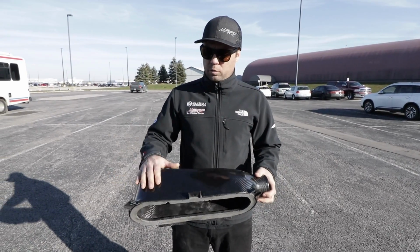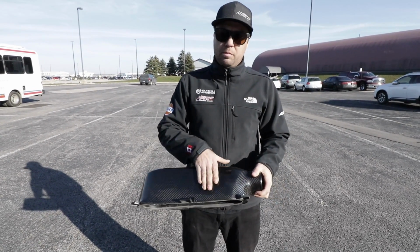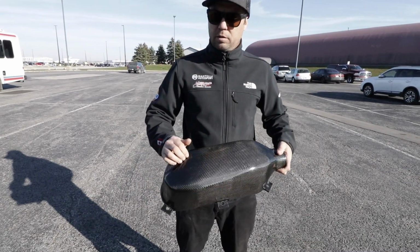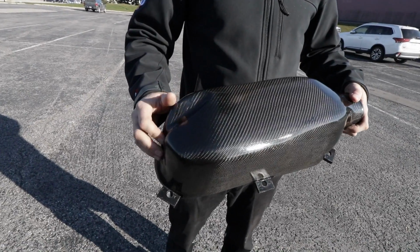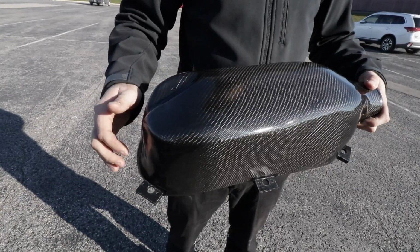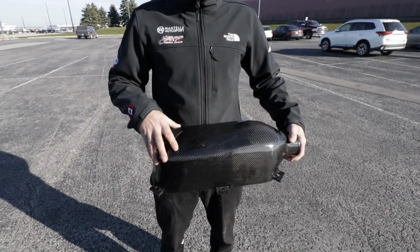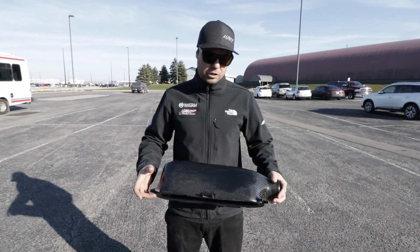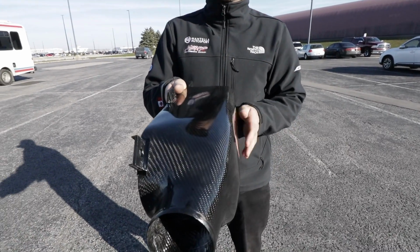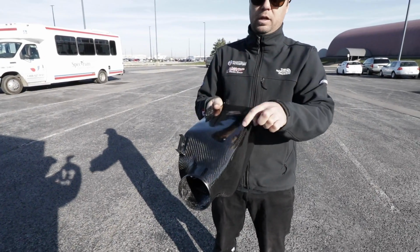From there, we had still some kind of just wonky shapes, so I did some body work on it, smoothed it all out, faired it in. Obviously still keeping our recession here for the cooler. It's a brake booster hose, or no? It's a coolant hose, right? Yeah, heater core hose. So that was kind of the one main thing that we needed for clearance in the S2000 engine bay, and also if you see, it's got a curved shape, so that follows down with the hood. So if we stayed on this plane the whole way, we'd be interfering with the hood.